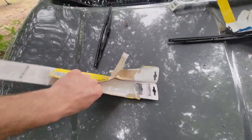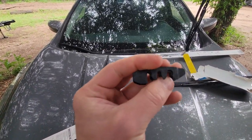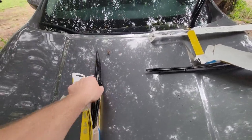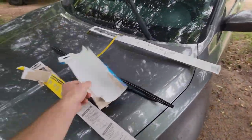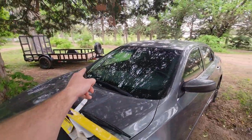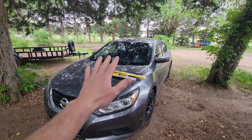You may have a different setup — you might have hooks that are not J hooks but little hooks that go into this, and you can swap those out if you need to. For ours we do not. So we're just gonna put the old blade in there, toss these things in the trash, put this one down, and just like that there we go. A 16 for your passenger side, a 28 for your driver's side, and now you'll have beautiful windshield wipers again in your Altima.